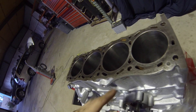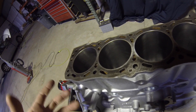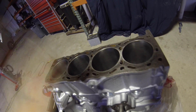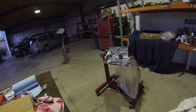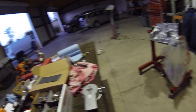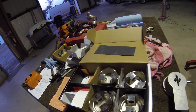I'll be able to start assembling everything. The first ring is 0.020, the second ring is 0.023, and you don't really have to gap the oil rails or expanding ring — just worry about the number one and number two rings. I hope you guys enjoyed the video. Let me know in the comments what you want to see as far as engine assembly. I'll try to film as much as I can, and if there's anything specific you want to see in more depth, let me know. See you guys in the next one!